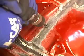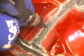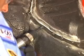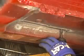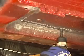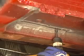With the spot welds exposed, they are removed by drilling them out with a special spot weld bit. The bit is only used to drill through the weld on the frame rail and therefore will not leave any holes in the panels that remain on the vehicle. This spot weld removal technique is used wherever spot welds will be made for attaching the new rail and where the backside of the other panel cannot be accessed for GMA MIG plug welding.